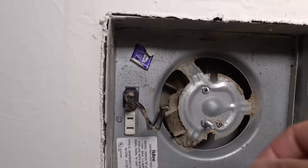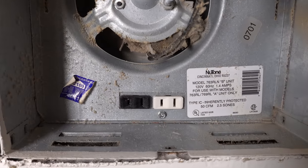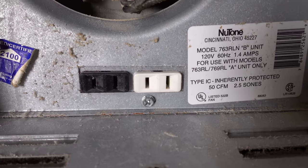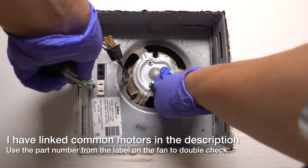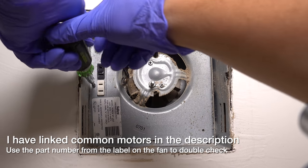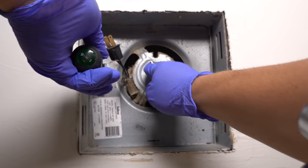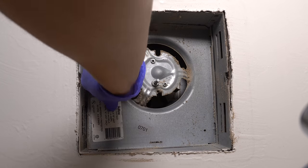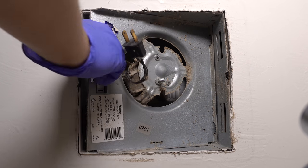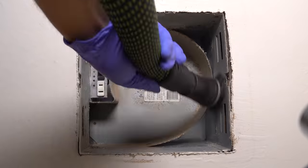In my case, I knew that the fan was dead because the motor was just humming and it wouldn't spin. Getting a brand new motor — which is like getting a new fan — only costs about $25 and it's simple to replace. Removing the motor is really easy; it's held on by just that single Phillips head screw below the outlets. Hold on to the housing so that it doesn't drop on you, and then just pull on the side of the screw and the motor housing should come right out. Now spend a few minutes to vacuum out the inside of the housing so that everything is nice and clean for your new install.